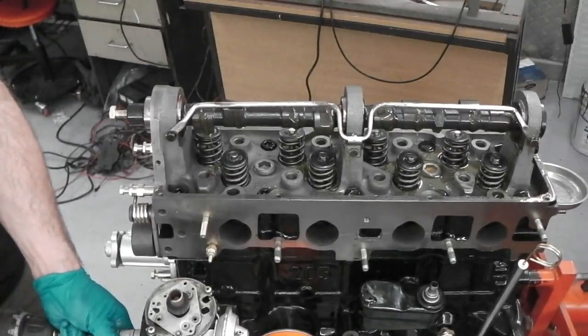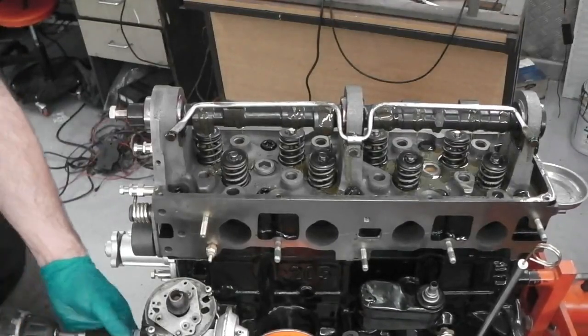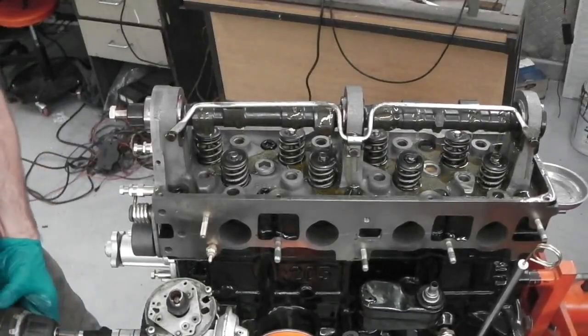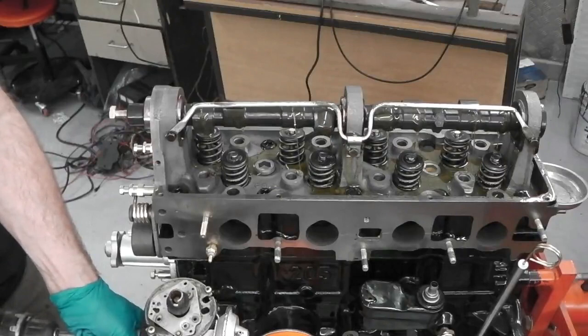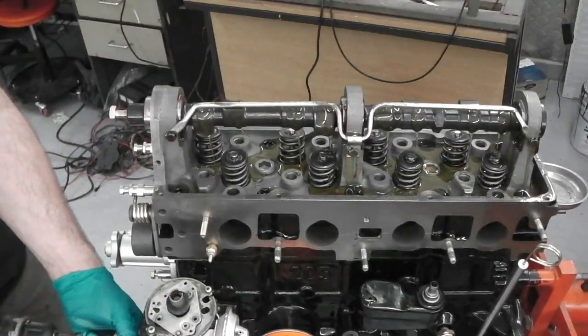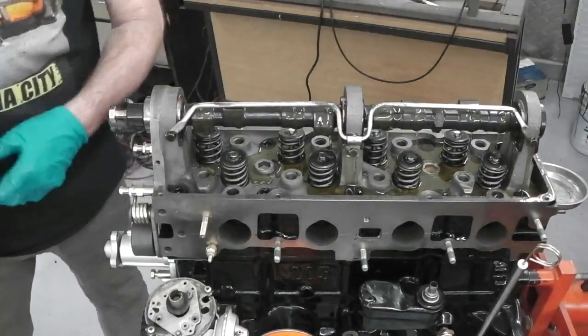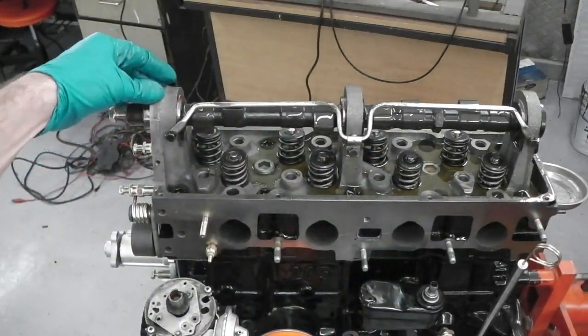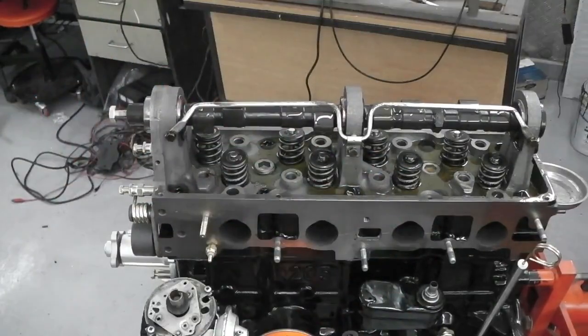There we go, as it builds up the pressure. Plenty of pressure there. So we know we're through. Oil is present in the engine, and now we leave that overnight. We'll see if we spot any leaks in the sump. I don't think we will, of course. Until that engine really turns over, you're never going to know for sure, but at least we're sort of primed and a little bit of oil is flowing around the network.